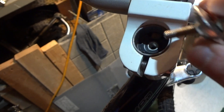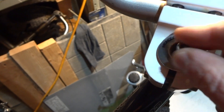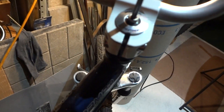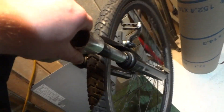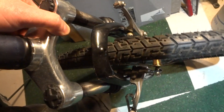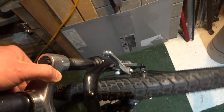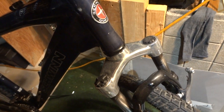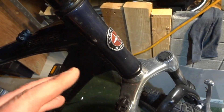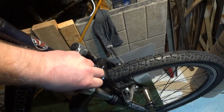This one doesn't fit properly — I've got to find the original — but right now just tighten this with your five millimeter to remove all the play from your steering. Make sure your fork is turning freely — you can hold it up in the air and check. You want it to turn freely and not be tight, but also make sure there's not too much play, which is what you were trying to fix in the first place.